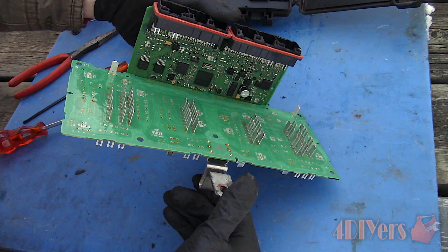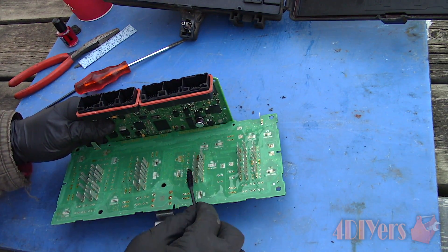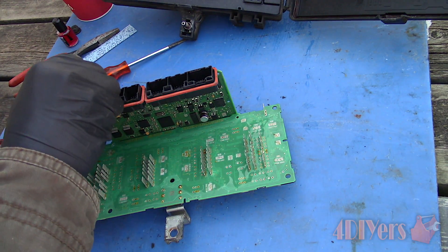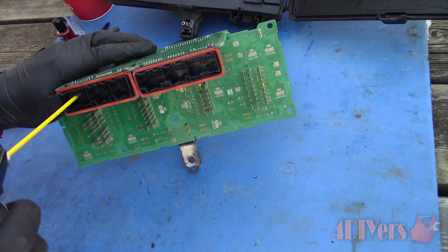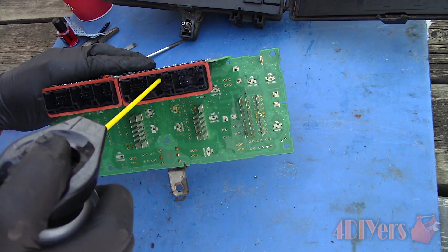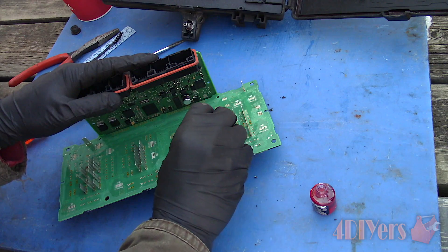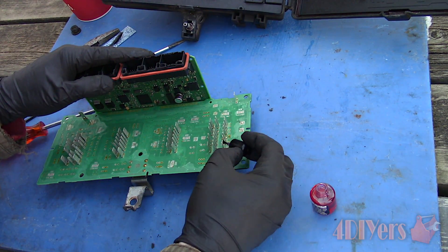Here's a view of the circuit board. Inspect for any corrosion — first is cleaning with a brush. For this I'm using Deoxit's Gold Kit, which comes with cleaning tools, corrosion remover and protectant. First, using the supplied round brush, clean the terminals of any debris. On the terminals which are still enclosed in the plastic casing, use Deoxit's D5 spray — this will dissolve any corrosion. Depending on the severity, you may need more than one application. The thinner solution allows for a flushing action to get into those tight spaces. For the exposed terminals, using the D100L and the supplied brush from the Gold Kit, apply it to the rest of the terminals.